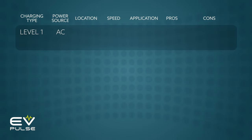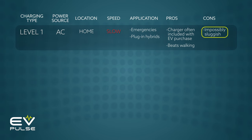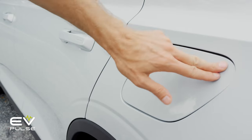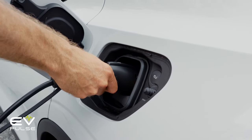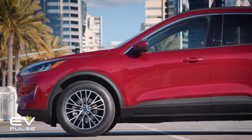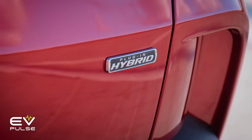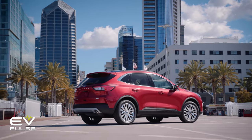Ideally, however, you'll never Level 1 charge your EV because it's so slow. Depending on the vehicle, you'll get three, maybe five miles of range per hour, which, in the grand scheme of things, is horrible — though it is still better than walking. I view Level 1 charging as an option of last resort, best left for emergency situations. About the only case where frequent Level 1 charging makes any sense is with plug-in hybrids, since their batteries are much smaller than those in all-electric vehicles, so they do charge up a lot faster.